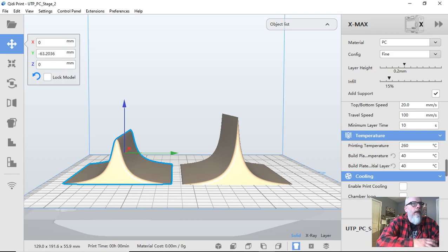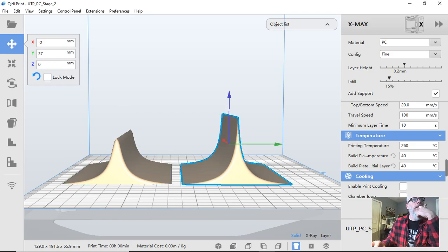The customer tells me a couple of things — I ask them a few questions — and then I determine what the runner length will be. Typically it's between an 11, 12, and 13 inch runner on average. Then I go for a 14 inch runner on a stage 1. Remember, it's about building torque when you're using a long runner intake manifold.